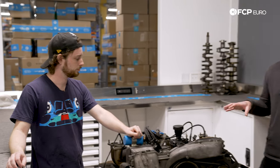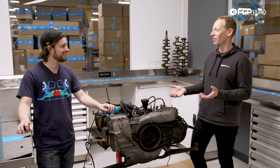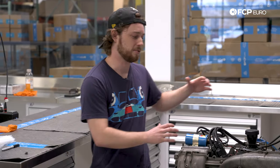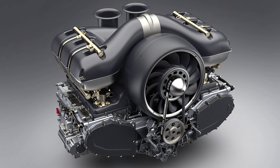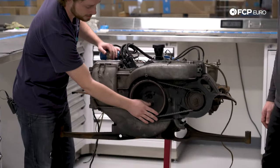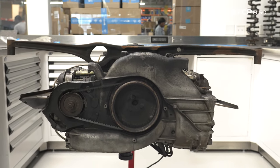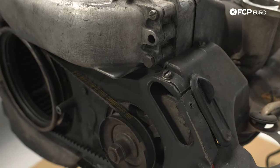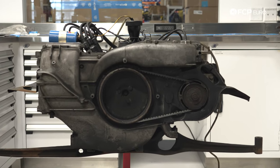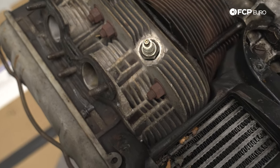Can you go over how the actual air-cooled section works? If you're familiar with an air-cooled engine, it's probably going to be the flat six from a Porsche 911, which has a big fan on the front that blows over the case. This is not the same — it's a similar design but smaller and more compact. At the front is your fan; it looks like the blower motor out of your heater system. It sucks in air and pushes it through this duct and over the engine, covered by these shrouds. The cylinders on both sides are finned — essentially heat sinks like you'd find in a computer — and the air blows over them to cool the cylinders and the oil.